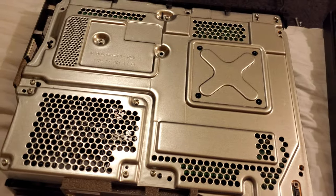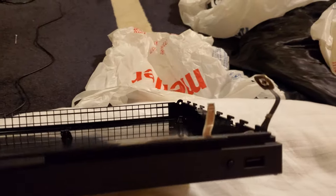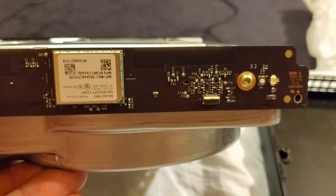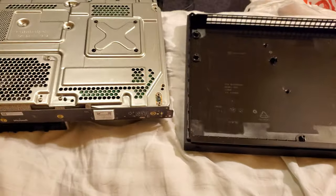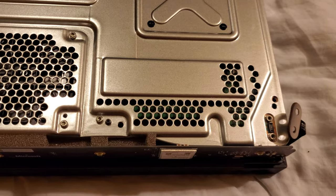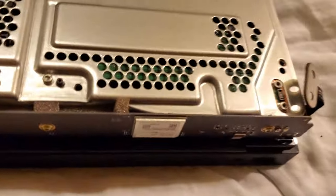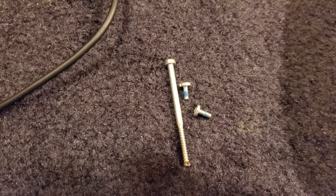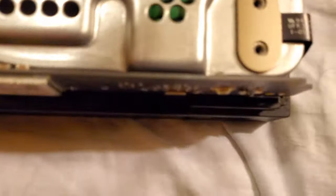Now with the Xbox case with the X clamp stamp facing upwards, take the bottom board which has the USB and syncing cable that plugs into this part — be very careful when hooking up and opening that connector. This is the cable that hooks up to this little tab here. Very carefully hook up the tab, then close it to lock it in place. Take the tab, match it along with the holes, then add these two small screws with blue thread-lock to this area here.